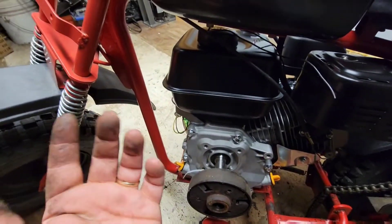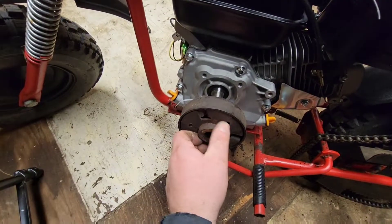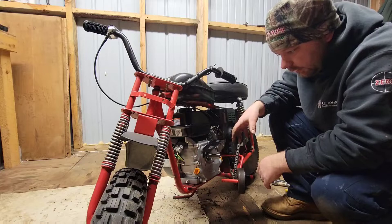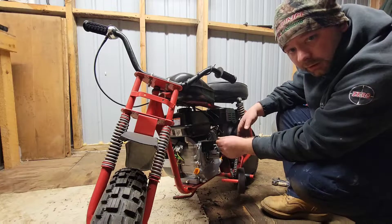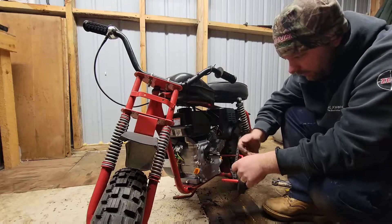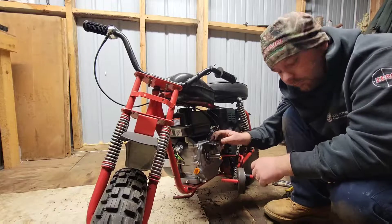Honestly, we're just about done. We have the throttle cable left to do, I'm not too worried about the kill switch yet, and we'll have to go pick up some oil. Before I get too excited and carried away — I'm throwing the clutch on and tightening up the bolts for the motor. I want to use the old chain guard still that was on the minibike. I cleaned up the bracket and took it off the old motor, so I'm going to bolt it back on so I can still use it. If you're doing something similar, don't forget about the washer that acts as a spacer on the crank for the clutch.